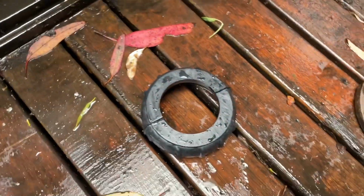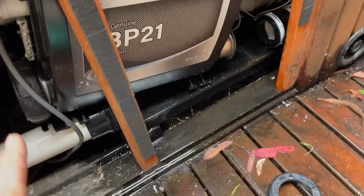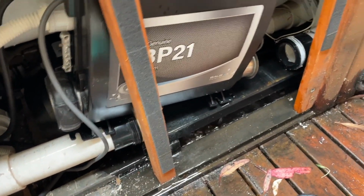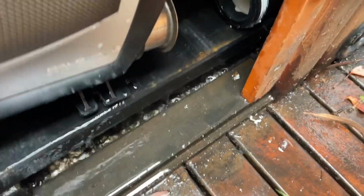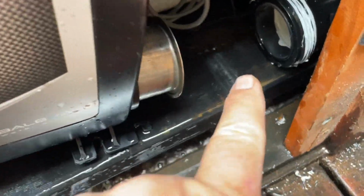So there is a fix you can do on this. For starters, if you've got just one end playing up, I switched the lock nuts from one end to the other to see if that made any difference, and the problem stayed on this side. So probably this here is a little bit undersized or something like that. There's no damage on the thread or breaks or anything like that. To make it run better, I did put a bit of Teflon tape on there just so it runs nicely without catching. And on this side here, the little tip is actually this split nut.